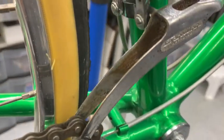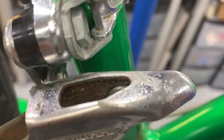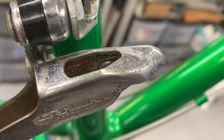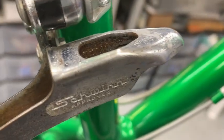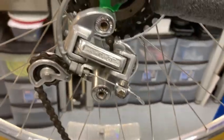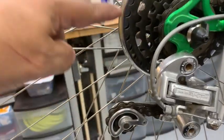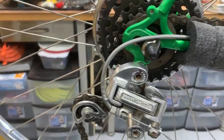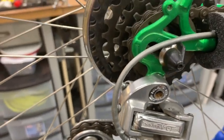And looking at this derailleur, it looks like it's kind of pitted and there's no going back on that. In this case, you could try to polish that, but you'll still see that pitting. These things I see online a lot. I'm gonna have to definitely change that cable. This cable here should really go straight out all the way to almost that gear. So it should go straight out and loop that way. That's why it's stressing right there. So we'll make that a little better.